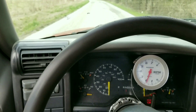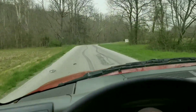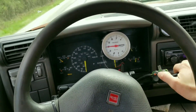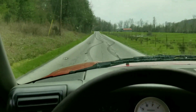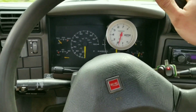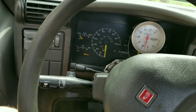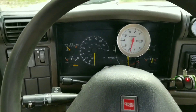I'm probably running about 45 right now, I can't really tell — I ain't got my GPS in here. Let me give you another little run through — first gear, first-second, third, fourth. It takes gear pretty good even when you're kind of getting on it. Now when it's wired like this, it bypasses the whole transmission computer and it does away with the line pressure settings. So when it's fully wired up like that, it's full line pressure at all times no matter what throttle you're in — light throttle, hard throttle, full throttle — full line pressure. So that's neck-breaking 1-2s right there for you.